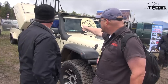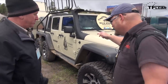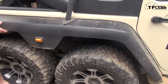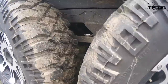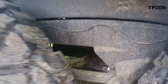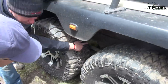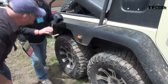You've made it into basically kind of a pickup truck as well in the back. Correct. We're fiberglass fabricators, so we did all of the fenders — we make them look like Jeep, but they bolt on about four inches taller. You can see the drive shaft in there. That drive shaft — because these are on sway bars, these articulate. I can get this wheel all the way above this wheel, and I can get this wheel all the way above that wheel. How cool. With the sway bars here. By doing that, you don't want to break your drive shaft that goes from the nine-inch Ford axle to the Jeep axle, so it collapses up to ten inches.